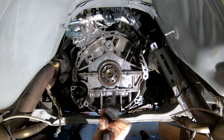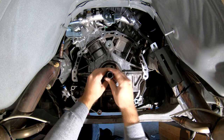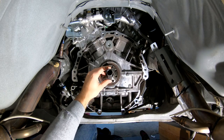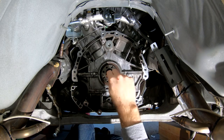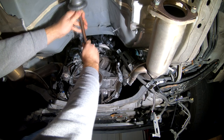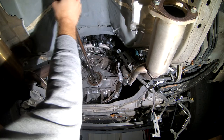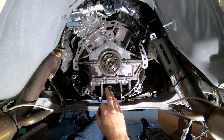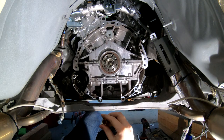With that small modification to the tool, I should be able to insert this through the pilot bushing now. You want to make sure you send the tool all the way to the back and then expand it out completely so it gets a good grip on that collar. Then we're going to insert the little sliding hammer to be able to bump the pilot bushing out of the seating. Both the puller as well as the sliding hammer you can rent from a local auto parts store.